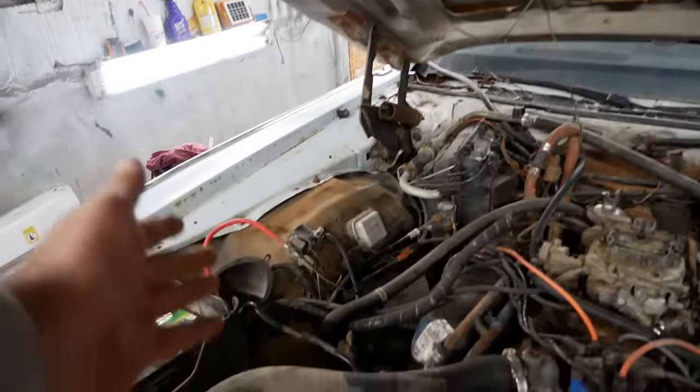I have 8 parts tractor paint. I'm going to add 1 part of the catalyst. That's about a pint per gallon. It's pretty cold out, so we're going to be a little more apt to get runs. So I'm not going to reduce it too much, but I am going to reduce it enough that we get a decent flow out, with a little naphtha, that's about 10% right there. On the money. I think I nailed the consistency of that. That's a nice looking flow out there. It's dripping. Maybe just a hair thin. It'll work for our purposes of not caring at all.